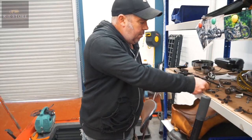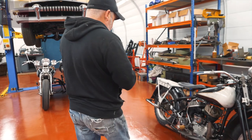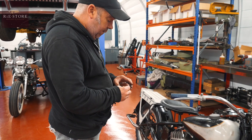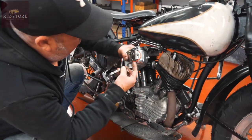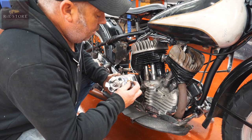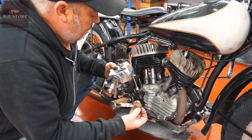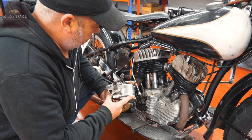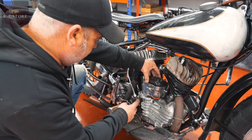We've also got to make something to hold the cable. The band around the base of the distributor just doesn't fit, so I'll probably take the band off, take the coil out of the inside of the magneto, drill and tap that brass piece in there — then that will let my cable come in through there and move it. It's a bit of brainstorming trying to work out exactly how to do it, but the basics are there now, just by machining that up.